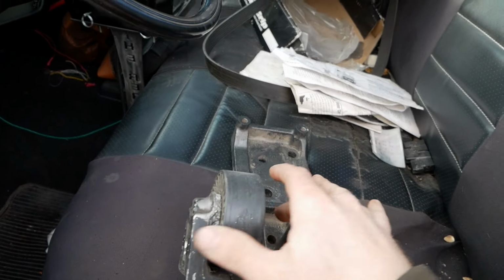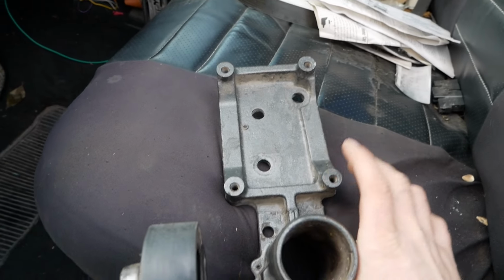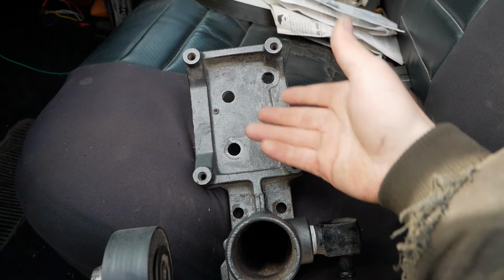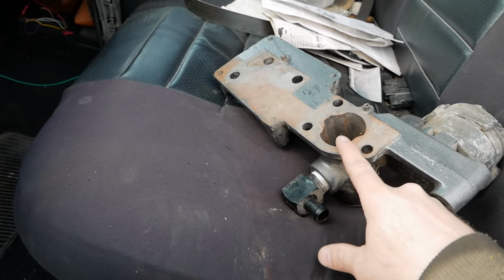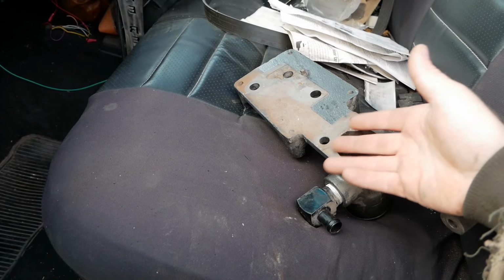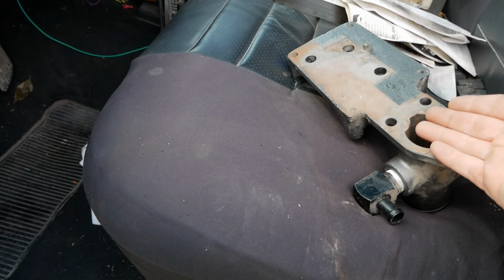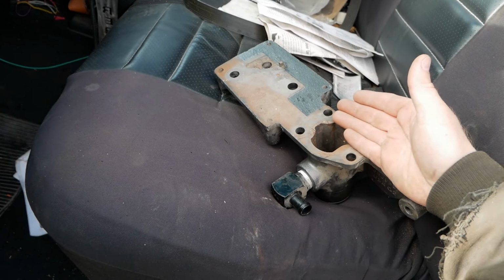There you are. That's what I'm looking for. This old most rare part for a 12 valve because they're hard to get and I don't think anybody makes them, and these were prone to cracking. The reason I know that is because we cracked the first one by over tightening the bolts on the block. So this essentially has a gasket that goes right here for your lower radiator hose and a coolant hose, and that seals it up. Well, for whatever reason, it didn't seal up, cracked, replaced it again. Somehow it had like two gaskets in it and it would never seal. So that was kind of the current state.